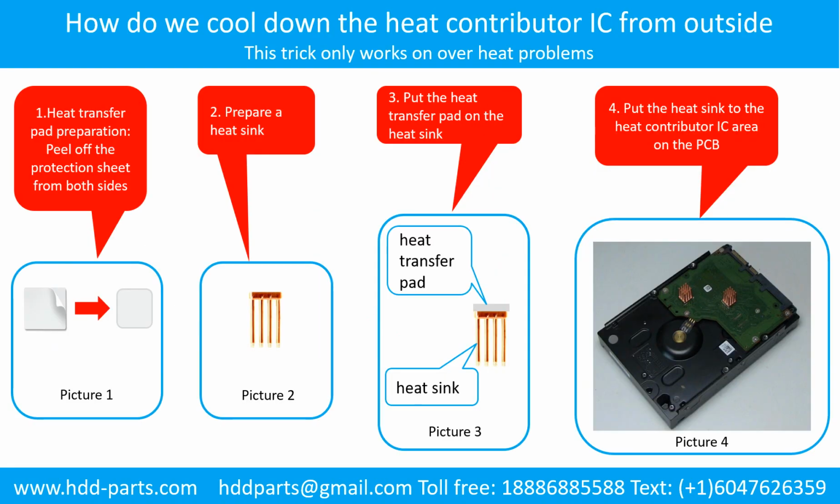How do we cool down the heat contributor IC from the outside? Step 1. Heat transfer pad preparation. Peel off the protection sheet from both sides of the heat transfer pad, like picture 1 shows. Step 2. Prepare a heat sink, like picture 2 shows. Step 3. Put the heat transfer pad onto the heat sink, like picture 3 shows. Step 4. Put the heat sink onto the heat contributor IC area on the PCB, like picture 4 shows.